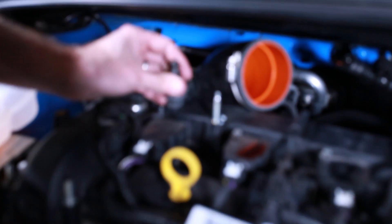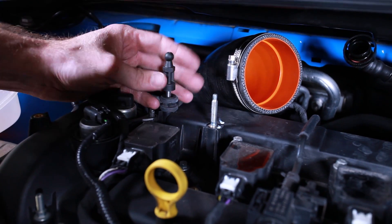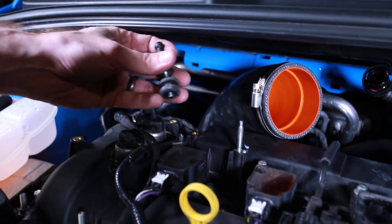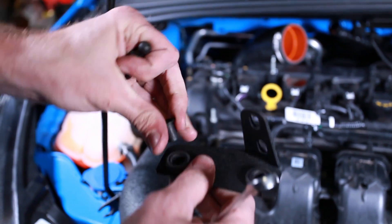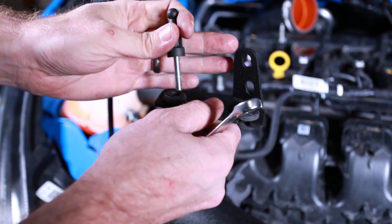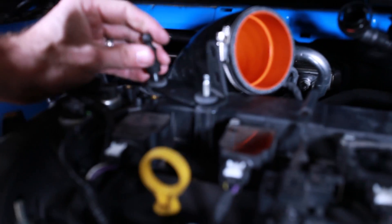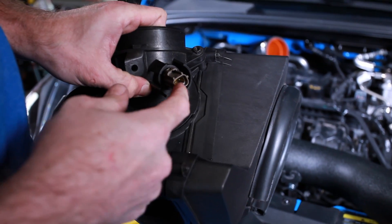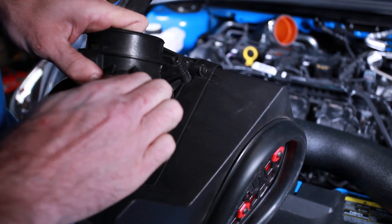This is the same feature on this little nub right here. I'm going to disconnect this — this little nipple is actually for installing the engine cover. Same situation: go ahead and remove that, slide it on like this, insert it, and now reinstall it back on the car just like this and screw it back down. You also have to take out this little sensor — just turn it counterclockwise about 90 degrees and you should be able to pull it out.